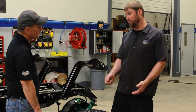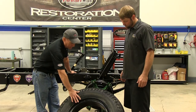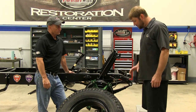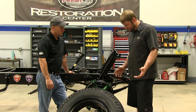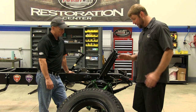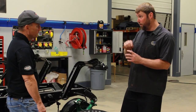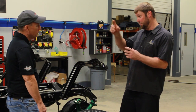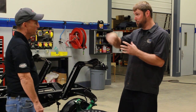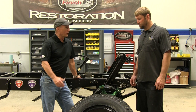Now that we've got these painted, we're going to do the installation. This is not like a normal car setup — it has little wedges that go all the way around and center it just right. You have to spin the wheel and tighten one up a little bit at a time to make sure it's nice and true, otherwise you're going to go down the road with the steering wheel shaking. The truer we get it, the smoother the ride.